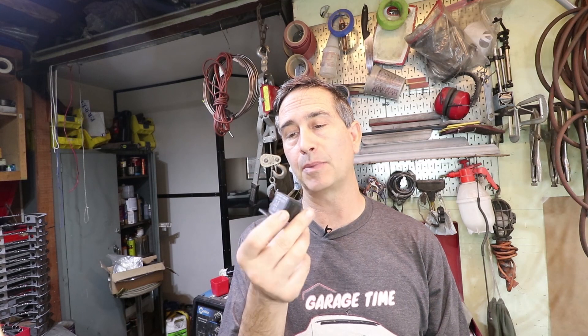This is the device right here. This is a 30 amp relay and it's from Tyco. Now I know these kits are available — you can get them on eBay and all kinds of places. But because this is a critical component, I wanted to get the best relay I could find. TE Electronics is also good. And I wanted to choose the wiring because it's in a high temperature location. I don't want the wiring to get loose and melt, so I wanted to build it myself.